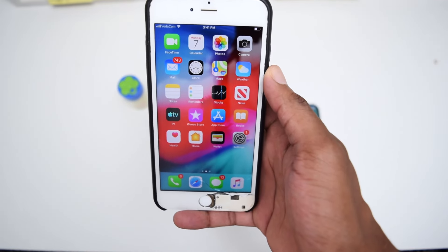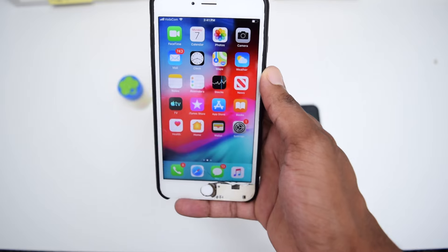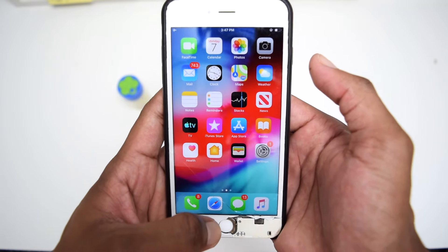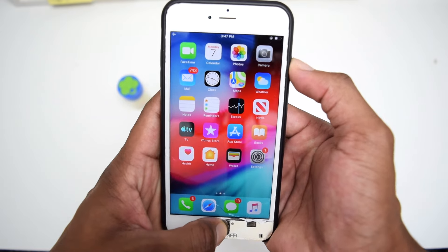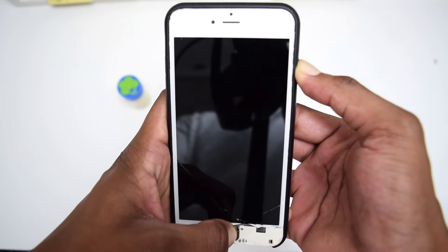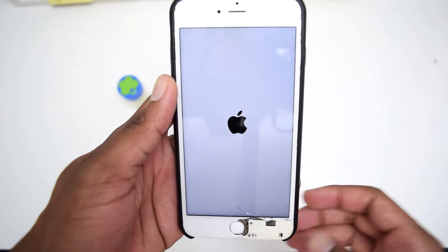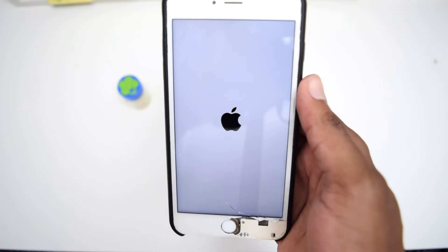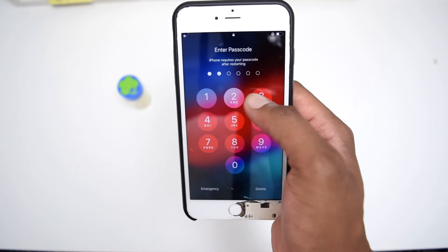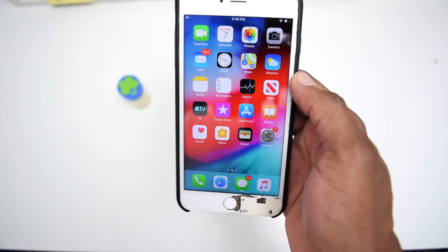To perform a hard restart on any iPhone up to iPhone 6 models — such as iPhone 5, 6, 6S, or 6 Plus — you need to press and hold the home button along with the power button simultaneously. Keep pressing both buttons continuously and your iPhone will automatically restart. Once you see the Apple logo on your screen, release the buttons and let the phone reboot. It takes a few seconds to restart. Once your iPhone has successfully restarted, simply unlock your phone and test the speakers to see if they sound better.